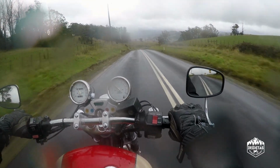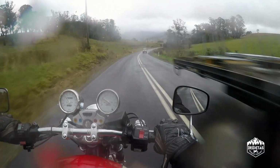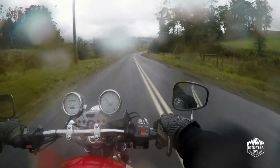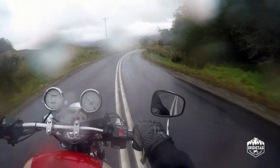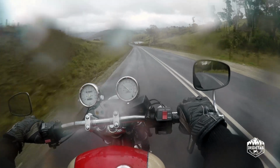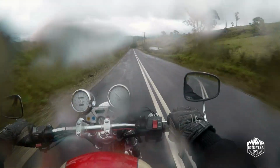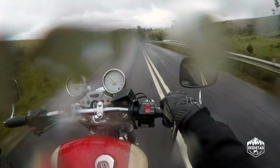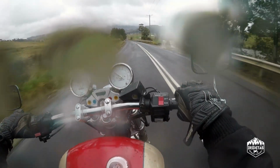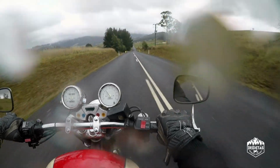Viragos are very tolerant of installing pod filters because it uses the frame as the airbox. So the pods aren't just flowing into the spigot of the carburetor, they're ultimately sort of flowing into the airbox, and the carburetor's drawing air from the actual top tube of the frame. So I have found, messing with Viragos, they are much more tolerant of changes to the intake than other bikes I've ever had, and it seems to be exactly the same here with the 750.